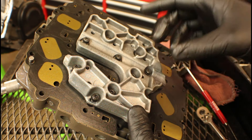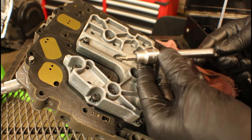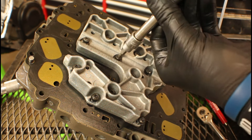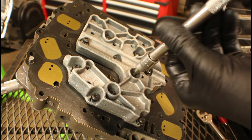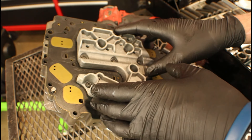I don't recommend using any cordless or air-powered tools for running those Torx bolts down. Just grab your T25 and extension and let's do it by hand. Now that we've got the fasteners ran down by hand, it's time to follow back up with a torque wrench.